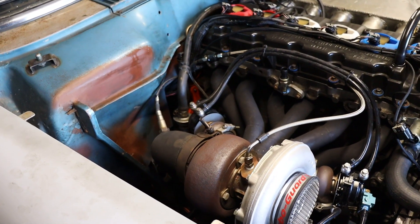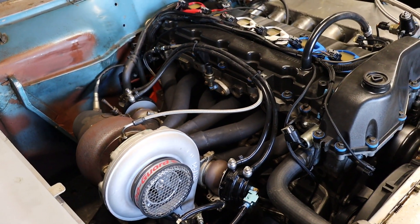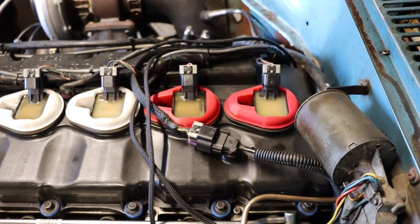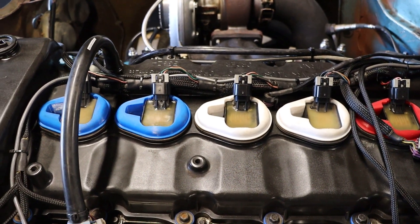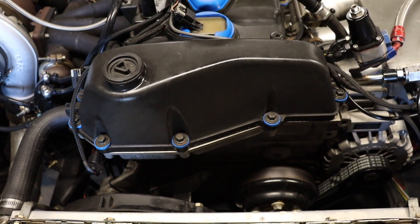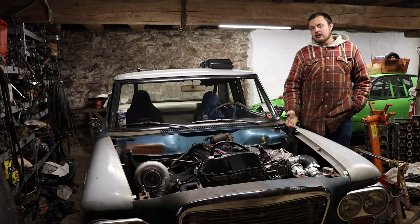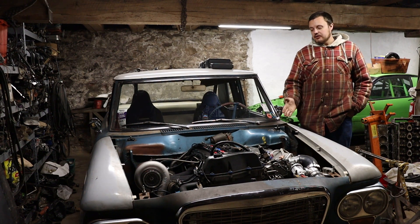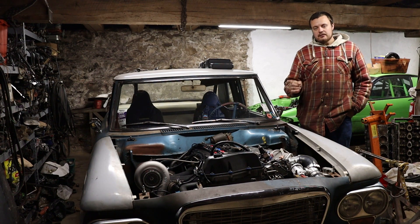If we don't, we can safely assume that it is a spark plug gap issue, which is causing the air and fuel mixture to not light off. That makes a low pressure condition inside the combustion chamber, which makes it so that the piston rings have a harder time sealing — because they rely on combustion to maintain a good seal — which allows crankcase pressure to make its way into the combustion chamber, and with it, oil. That oil contaminates the spark plug and makes the situation even worse. We've actually had this happen on another engine where one of the spark plugs got oil on it. We inspected everything like we're going to do today, put a new spark plug in it, and the problem went away. So let's get to work and see if there's a problem.